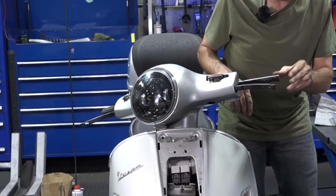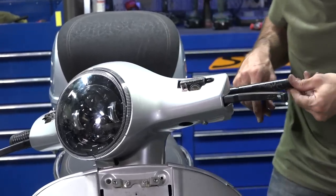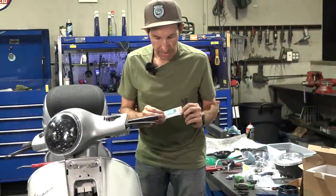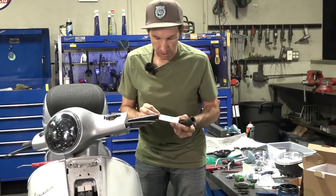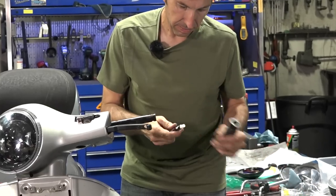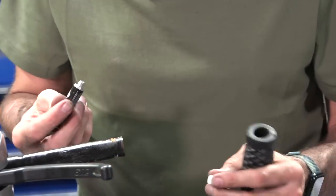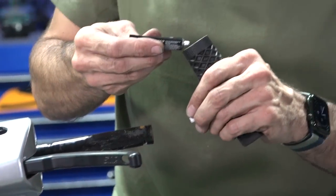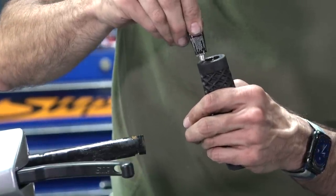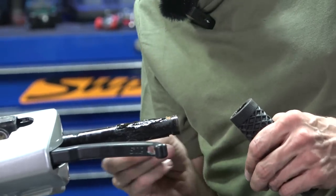The reason I saved this grip for last is because I want the grip to stop right at the plastic of the handlebar — it's hard to judge that point until you get the handlebar covers on. I got the grip ends cut out and we have a tube of grip glue — on the Scooter West web store it's Tool GG. It's kind of like pig snot; you have to puncture the end. Put some of it inside the grip on the side that goes in — it acts like a lubricant at first, and then the glue dries up.